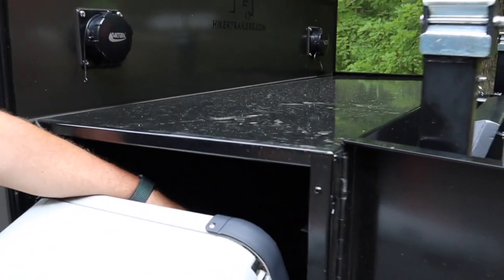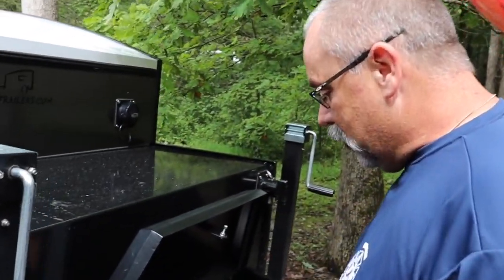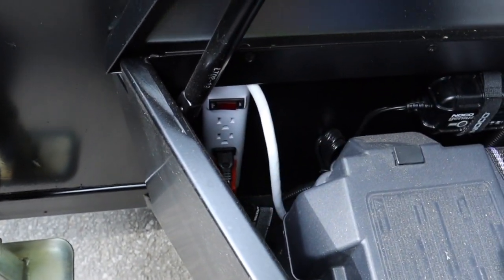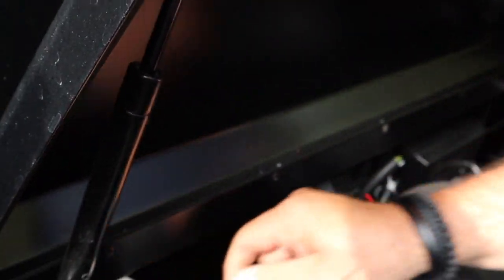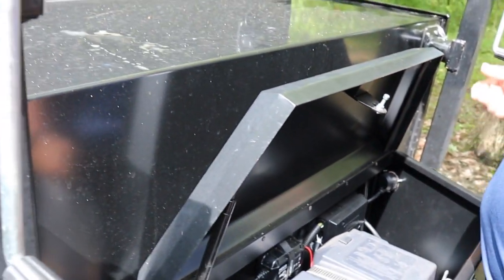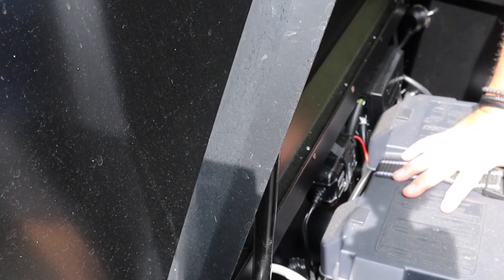If you look down in here — it's pretty dark — but there's two plugs down in there: a 12-volt DC plug and an AC plug, both plugged into the back of the refrigerator. What Wes did is he set up the battery system so that I have a power strip here, and one of the AC plugs that goes to this box plugs in here, then this plug goes all the way to the back to another power strip. The DC plug for the refrigerator comes off the battery. I also have plugged into this power strip my charger. The power strip comes out right here, which is a 3-prong plug on the outside. So when I get to camp, if I've got power, I hook it to the shore power and plug in right there — now my refrigerator is running off shore power and my battery is charging.